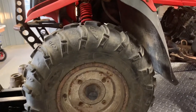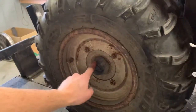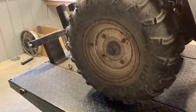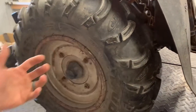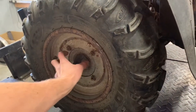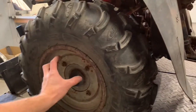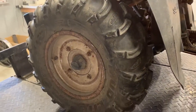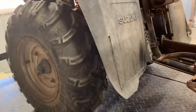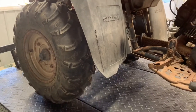The left-hand side is almost identical to the right-hand side on this front end. You've got your axle cap and your lug nuts — those are 14mm lug nuts. Remove those lug nuts and your rim will pop off. You've got a hub drum brake assembly up front. You have to pull this entire assembly off to replace those brake shoes — there's another video on that on my channel.